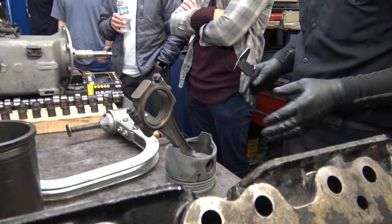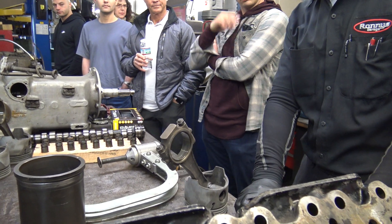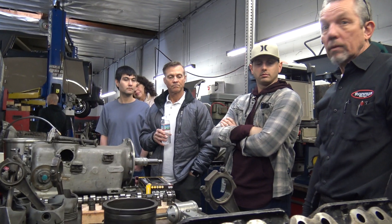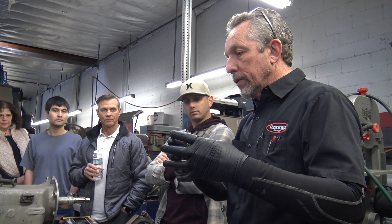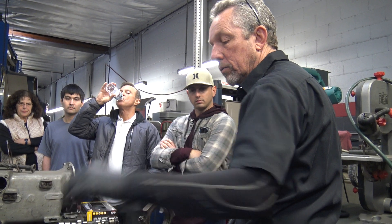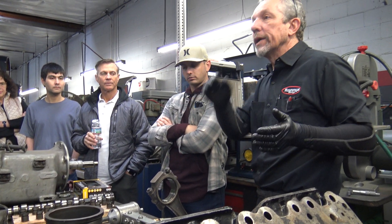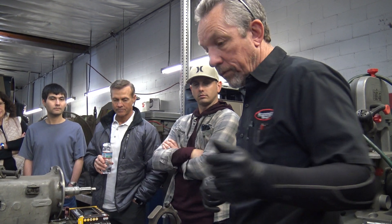A lot of people — I'll touch on that. The other one has Chevy pistons in it, or Chevy type. The big difference between the aftermarket pistons and the factory pistons is these are forged, high quality — they don't expand much when they get hot. A lot of the billet ones might be high quality aluminum, but they expand a lot. So these are essentially zero clearance when they're new. You put a Chevy piston in, I think you get three, four thousandths out of them, because they're going to expand so much it'll get rid of the noise. But they make noise up to that point, and that's just not acceptable on a PMC — Proper Motor Cars, for those of you who don't know.